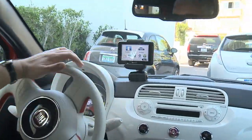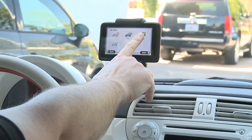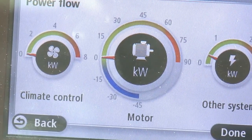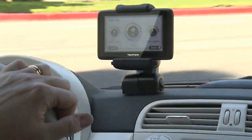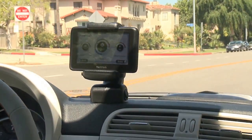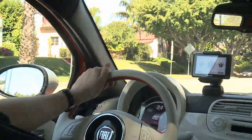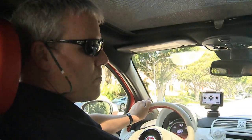The TomTom is actually integrated to work with the 500E. If you push this little car menu button, it now gives you a chance to look at trip and energy screens. The energy display is actually pretty cool — power flow. What you see there is three big dials. The one on the left is climate control; right now I'm pulling a couple hundred watts into the air conditioner to keep it nice and cool in this LA traffic. The middle one shows the motor and how much energy that's using to move us down the road. The one on the right is everything else — the 12-volt system. If you let up on the gas a bit, you see how it goes into the blue, and when you touch your brakes it goes down a little bit farther, telling you you're recovering that energy and putting it right back in the battery again.